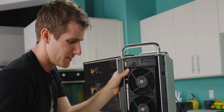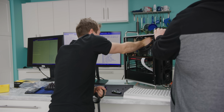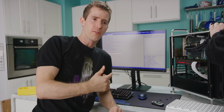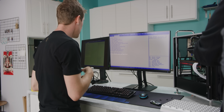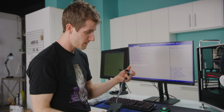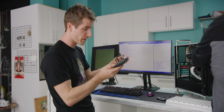That's better. So shockingly, the BIOS of this motherboard has absolutely no way to configure the fan curve. So what I think is happening is because the temps are so low, it's turning the fan off and then cranking it back up and just getting real confused. But unfortunately on this BIOS, there's absolutely no way whatsoever to control that setting. So I went and got a Commander Pro and we're gonna plug that in. That is a totally overkill and unnecessary solution, but here we are.